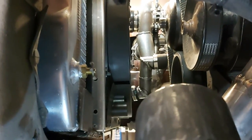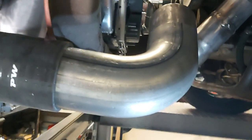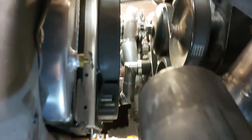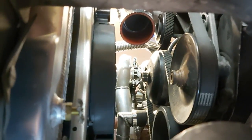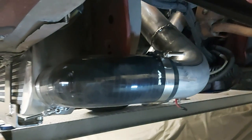Then I'll put another scene on showing how the completed system of boost going into our intercooler, then boost coming out going by the blow-off valve and into our intake looks. Basically the procedure is just using a bunch of couplers — 90-degree here coming out, then a piece of three-inch exhaust pipe. We're going to measure from the end of this one about an inch and a half into that guy up there to get our length, weld it up, and put everything together. I should have bought clamps yesterday but I was busy, so I'll go get them tomorrow.